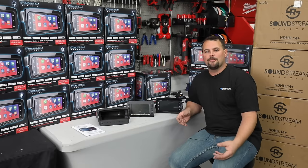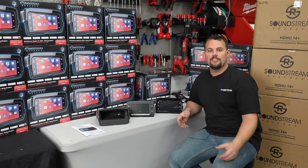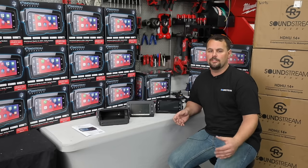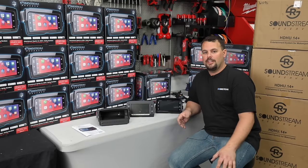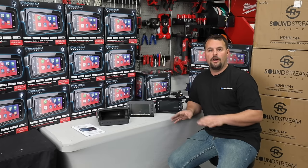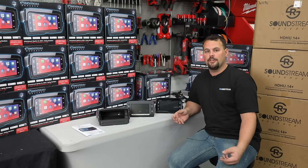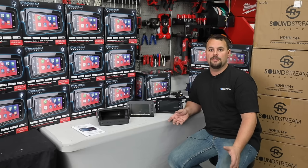I've watched some other reviews from people who haven't even got the radio yet, already kind of talking it down without experiencing what it can do. If we're going to do an audio upgrade on your motorcycle, we always try to do this the very best way we can. If we're using a factory radio, we have to flash it — we're flashing it to correct an awful EQ that Harley puts in factory. They're trying to make it sound really good while you're sitting still, but with their factory EQ curves while moving at speed — highway speeds or more — you can't hear your radio and it just seems to distort a lot.